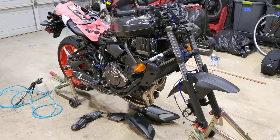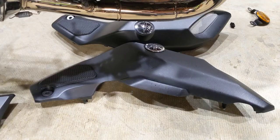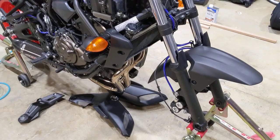What you will need to take off in order to get this line installed is not the entire tank shroud — you don't need to take that whole thing off. Just the right side tank shroud and the headlight assembly. There are four bolts: one here and a second one on the headlight. The wheels are off too because I did the rotors as well.